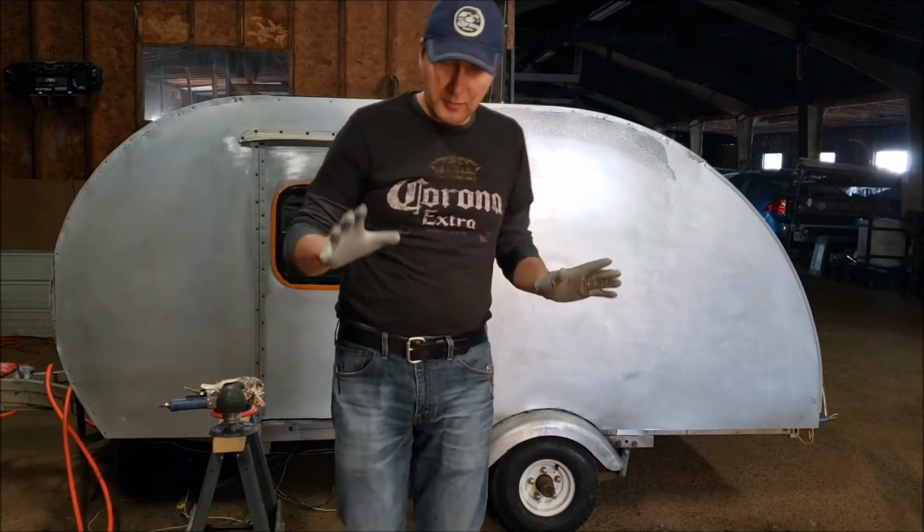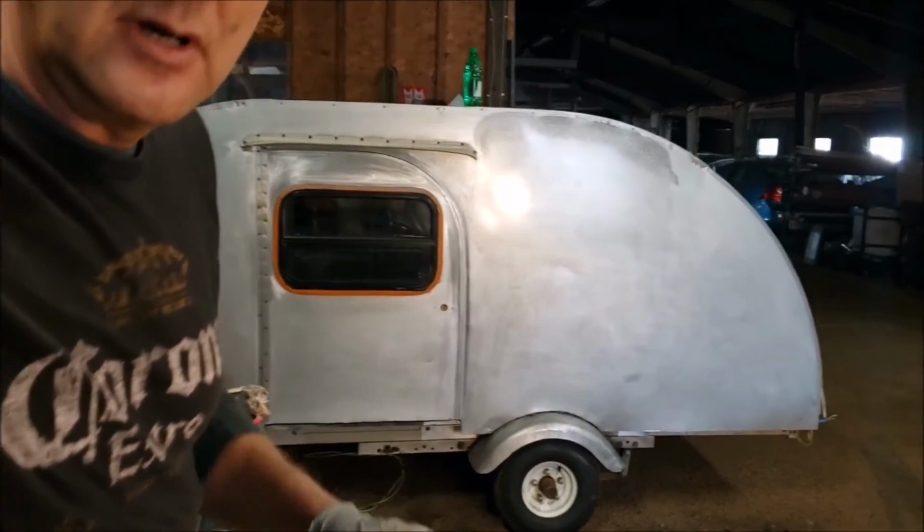600. Let's see how this came out. As you see, this is 320, so we see the marks. This is not dirt, this is the sandpaper imperfections from when we were sanding. You see those marks were everywhere, and they are still there, but this is the finish with the 600. All those imperfections are actually gone, and this is only the beginning of our sanding.